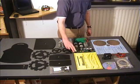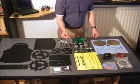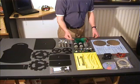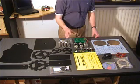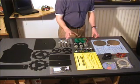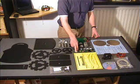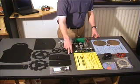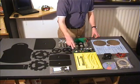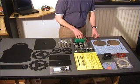This second PCB is used for what we call the buried wire fence — that is, surrounding the area in which you want the mower to stay. It creates a signal that is transmitted through the buried wire. It is also the charging device, creating a constant current for charging the nickel metal hydride accumulator.